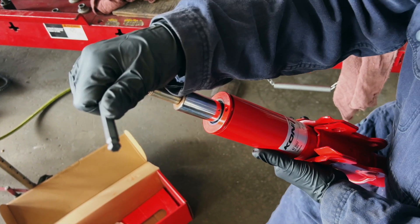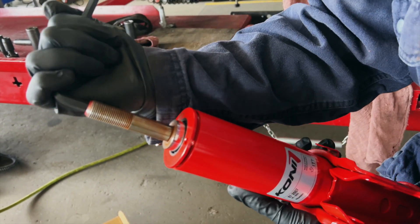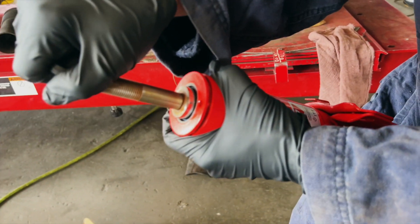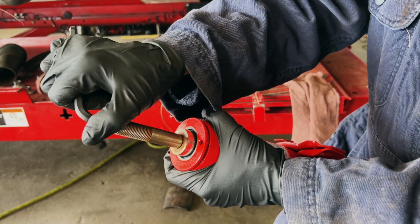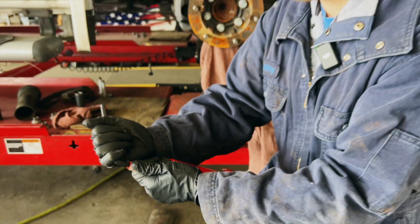So we're going to compress it and then rotate it to make sure those cams engage. See how it dropped in there? Then I'm going to rotate it counterclockwise to make sure it's fully backed off — and it is; I can't go any further counterclockwise. It's important to note, especially when using a tool that gives you more leverage, do not force it beyond the extremes of adjustment.